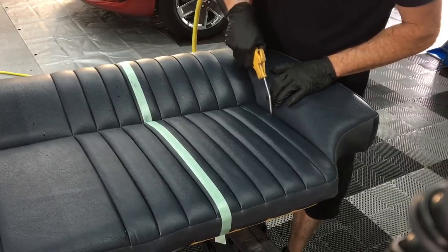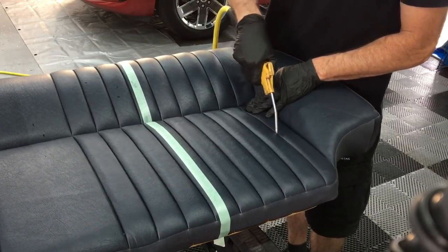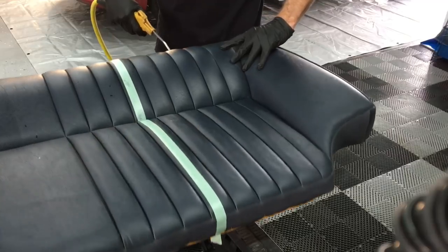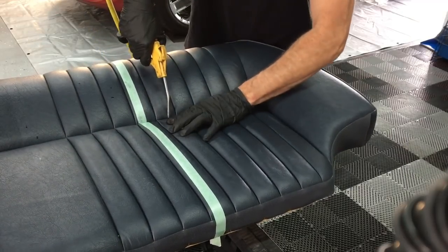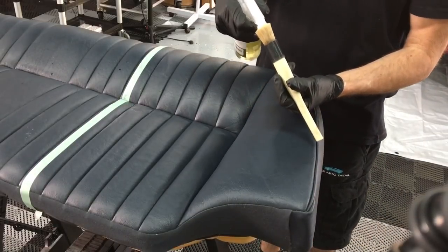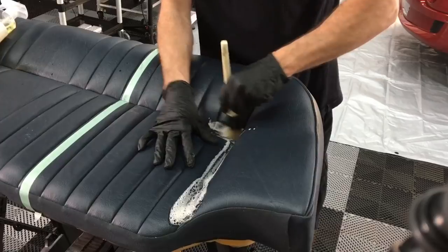You want to work your way from the seams out — the seams are the most important areas to get clean. That's where dirt settles, and as you're sliding in and out of the car, those patches rub together causing premature wear to the top coat and stitching. Start with forced air, or grab a soft detail brush to get loose dirt out. Stay away from vacuum cleaners unless you have a rubber nozzle, as that could scuff the top coat. Follow that up with a dedicated leather cleaner — this one lathers up really nicely. Continue cleaning the seams and stitching and work your way outward.